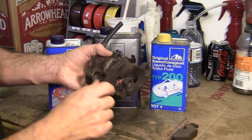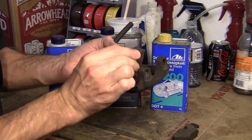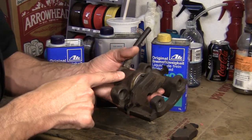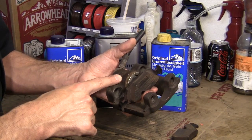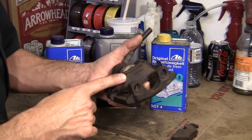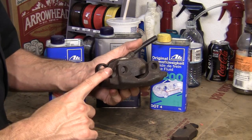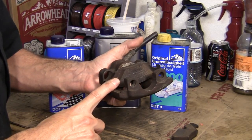So this is a brake caliper. These are pads. Your inboard pad is connected into this piston. This piston has a lot of brake fluid surrounding it. When the hydraulic pressure pushes this piston out, this pad will rub against the rotor and create a lot of heat from friction. That heat will get transferred through the pad and through the piston and into the fluid. New dry DOT 4 fluid will boil at around 230 Celsius. But moisture content will make it boil at a lower temperature. If the brake fluid has absorbed as much as 5% moisture, which is possible over a few years, then the boiling point may drop by half. Under heavy braking when the brakes are hot enough, the boiling brake fluid will have bubbles — those bubbles make the fluid compressible and that's called brake fade.